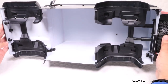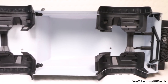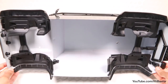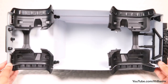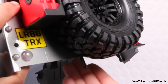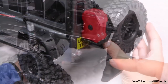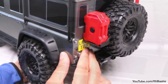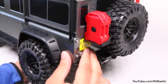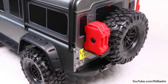Taking a look under the body, the chassis has thick moulded plastic bumpers and hard plastic rock sliders for rock riding. The body itself also has arch liners to protect the chassis from the elements, though this all adds some sprung weight to the overall vehicle. Notice the two pins on the rear of the body — these line up with two post locators in the rear bumper, lining the rest of the body up nicely on two posts up front and two higher posts at the rear, all working to secure the body to the vehicle, minimising any movement or rattle.